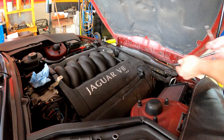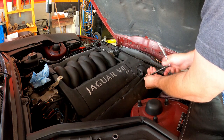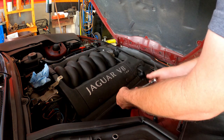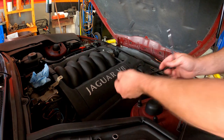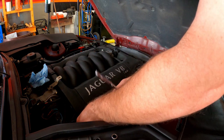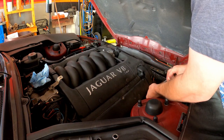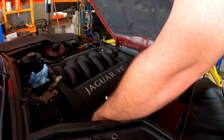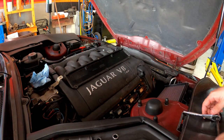What we have here is a 7mm headed bolt. These should not be on very tight, and you don't want to go back down real tight either. This is all plastic, so as I always mention on these older cars, be careful — it will crack and break quite easily. I'm using a swivel headed socket to make it easier to get to some of these lower bolts. The cover is off.